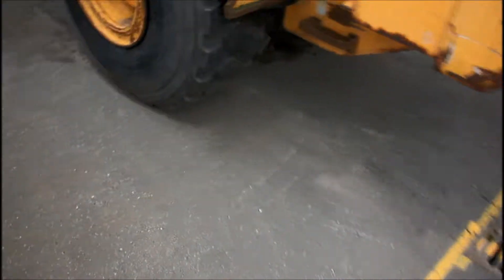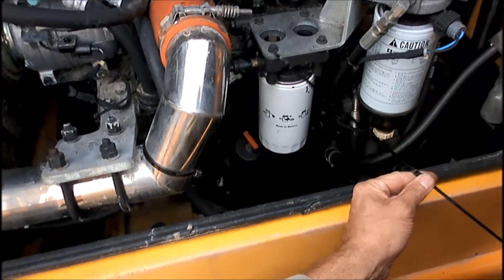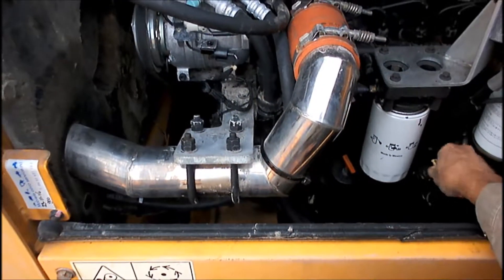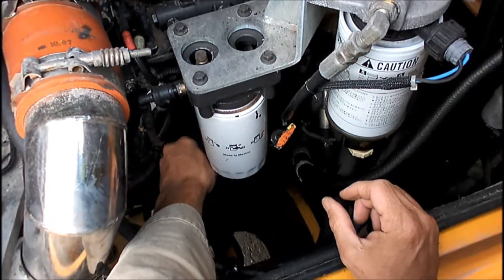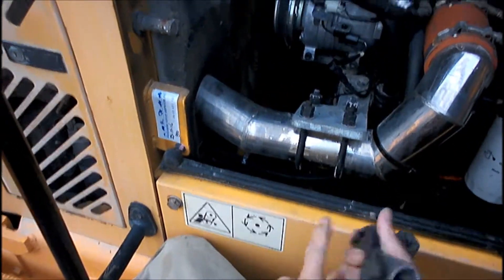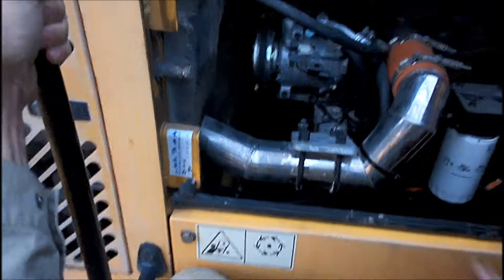When this is done, the inspector starts the engine. Of course, before he does, he checks the oil level. When the engine is running, we check the condition of the oil — what is the color, is it dark or recent? Most importantly, we check if there is any water or contamination in the oil, and what is the blow-by. This gives a rough idea about the engine condition.